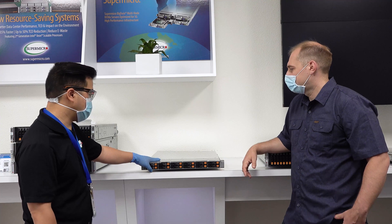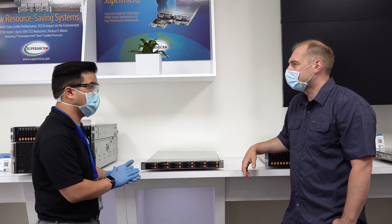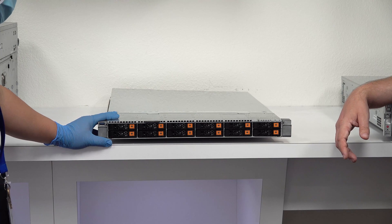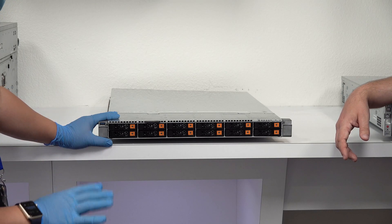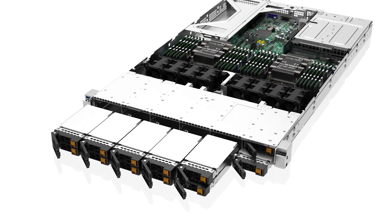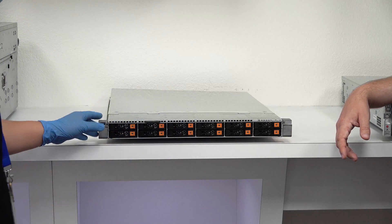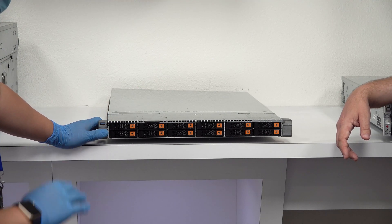Basically, in this particular case, the only contrast is that when you double up in the 1U itself, you'll have additional CPU and memory requirements. But in terms of drive density, the 1U 12 adds 20% more storage by adding the extra two drives, using standard 2.5-inch 15mm drives. This is what we call a full hybrid solution — each drive bay supports NVMe, SATA, as well as SAS if there's a storage controller installed. The platform is also balanced: the first six drives come off CPU 1 and the second six off CPU 2, for a total of 48 PCIe lanes allocated to these drives.